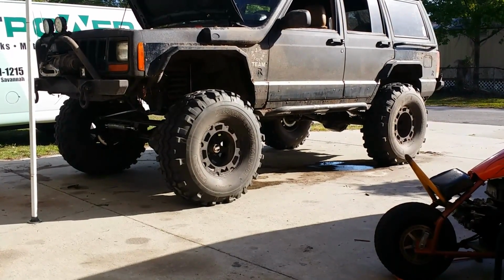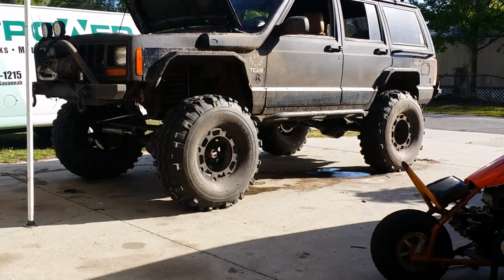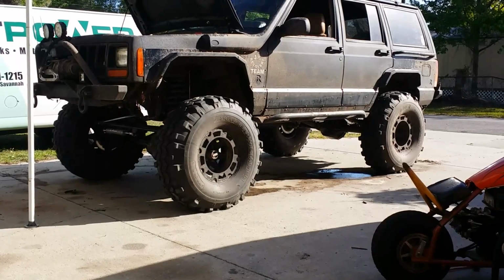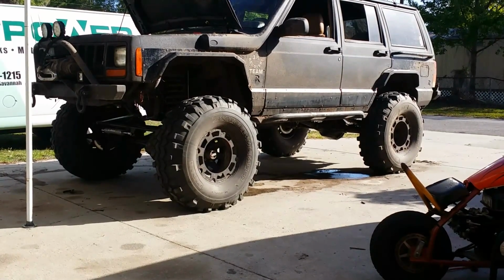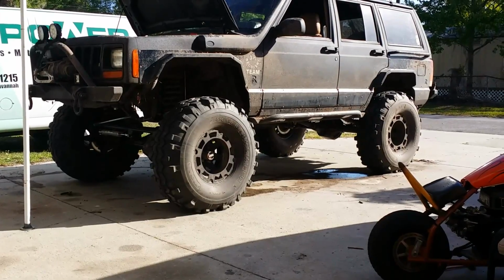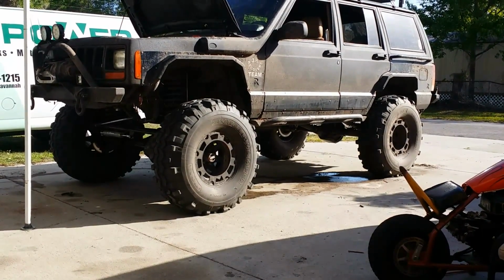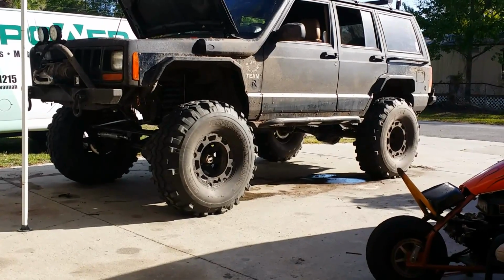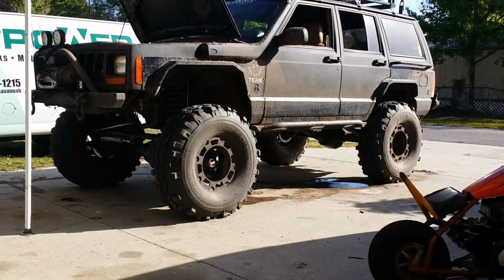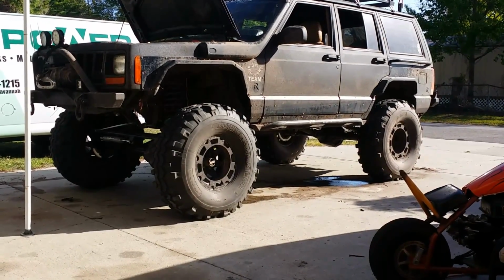But I beat on it like that a lot since I've had this Jeep. But usually it's on a 3-day weekend where I'm going to be out there camping and I ain't got to worry about working on it for a few days, and it holds up. The only thing I go through is starters and alternators, because they're down in the water. And I thought about relocating that alternator, but I don't want to lose my AC, and I don't want to move my AC down because I'd rather buy an alternator and a clutch. You can get them to warranty it a couple times.